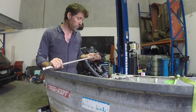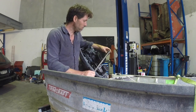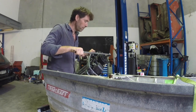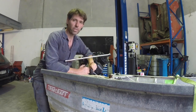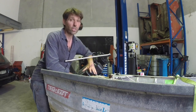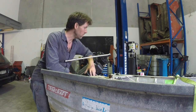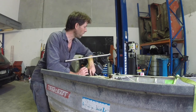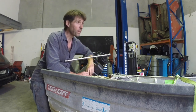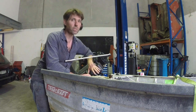I'll put a breaker bar here and we'll see if we can rock it a little bit. Your average breaker bar is pretty long, which means you can generate quite a bit of force and put a lot of torque on this socket. The golden rule is do no harm - I'm just looking to do this relatively gently, just to see whether it moves at all. It's moving a little bit. There's no doubt with a breaker bar this long you could put your back into it and get this engine to move, but there's a good chance you'd end up damaging the rings inside it. So we're just looking to see if it's moving at all. Then maybe let it sit a bit longer, because once it's moved it's reaching a different part of the bore - maybe with a bit less corrosion, a bit more chance for the oil to come in. Short and steady wins the race with this - it is a little bit of a patience game.